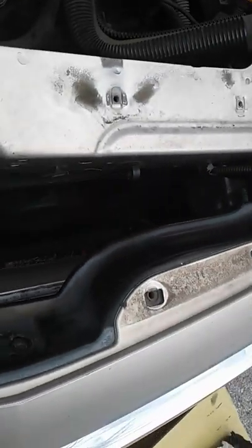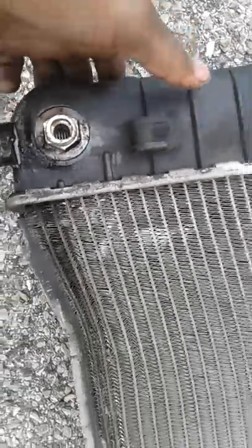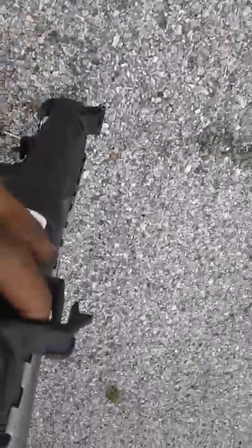With that access you'll have this gaping hole right here. The condenser is actually screwed onto the radiator with about two 10-millimeter bolts and is held on from the top, so you gotta pull the radiator up a little bit so it latches off. There's a 10 down there and another one on the other side — it's like a little latch lip right here. These are where those two little metal prongs slide into and then they bolt down on both sides.